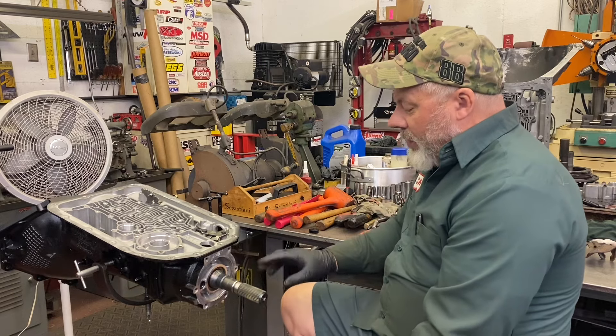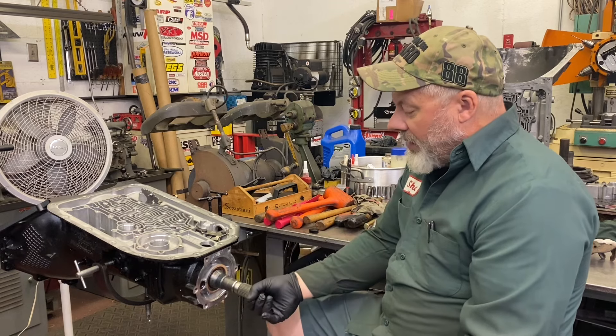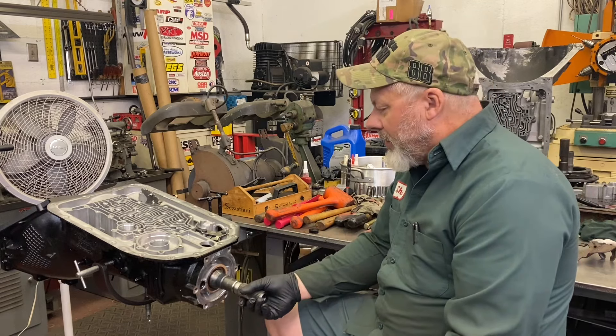So you've got to deal with these. This was a bolt-on yoke transmission, so I have ground off the O-ring grooves — I put this in the lathe, held my grinder right there, and removed the O-ring grooves. So now a regular slip yoke, Turbo 400 size, will fit.